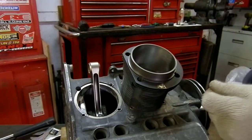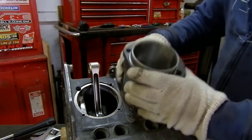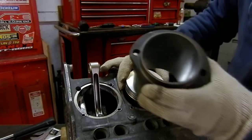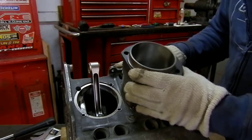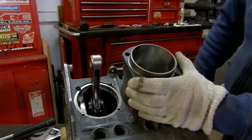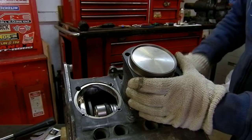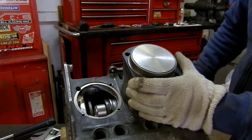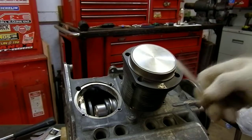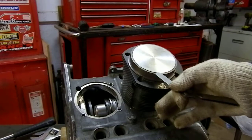One of the things that you have to do is what I call a stack up. What I've done is taken the rings off the piston and put the cylinder into place, then rotate it around until I bring the piston up to top dead center and maybe beyond. I've already measured this and you can see in the video that the piston is actually coming above the deck surface. I can touch my feeler gauge on the top of it.